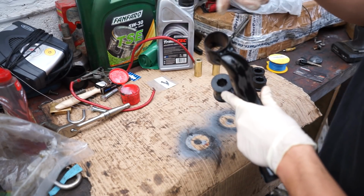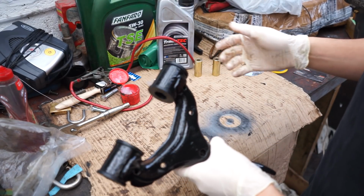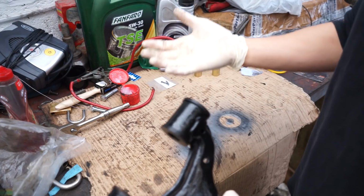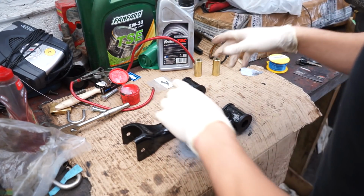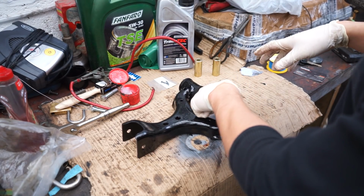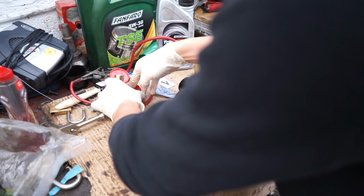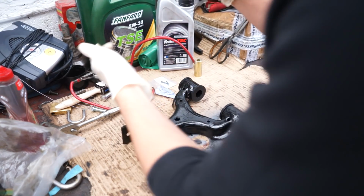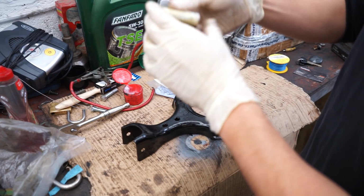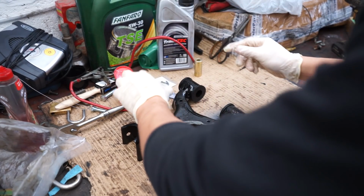We'll do the same again now on this bit. I actually think that was easier as a job than it was when we used the grease last week, so that is a bit of a benefit. Now let's put the pins in. That does require the grease because that makes sure that in the longer term the pins don't start squeaking against the bushing. So obviously in this case, again, it's slightly different. Get some of the grease, wrap it around the pin all the way through, and then a little bit on the bush.